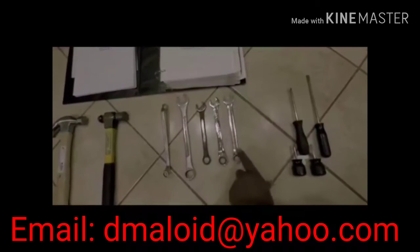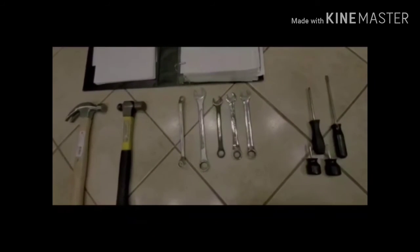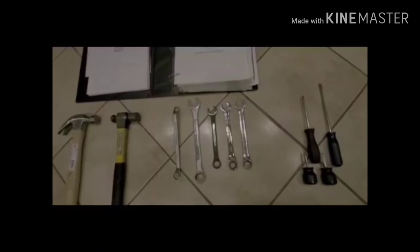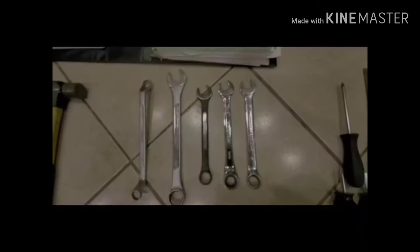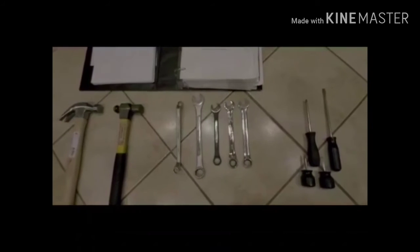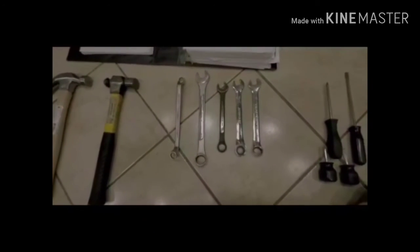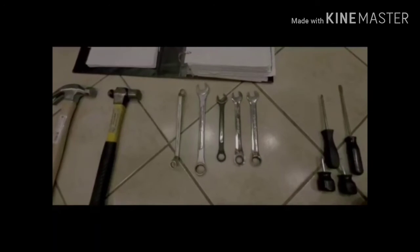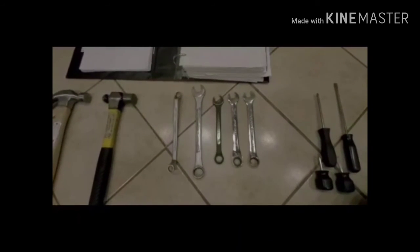The different sizes and applications for wrenches come in two types: SAE, which is American Standard — your fractional sizes — and metric, which is your decimal sizes: 13s, 14s, 15s, 16s, 17s, and so on. I have a mixture of all. A good mechanic should have both SAE and metric because whatever car you drive will require the tools rated for the nuts and bolts used to assemble it. Most foreign cars — Japanese, European, German — are usually metric, and most American cars are SAE.